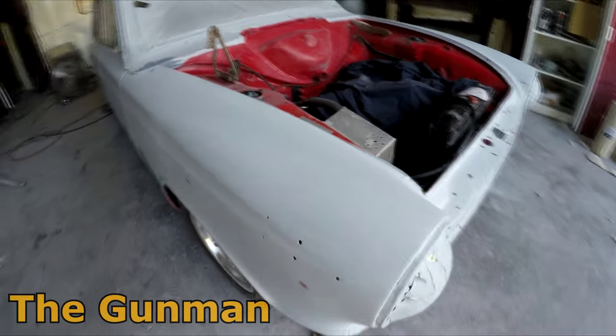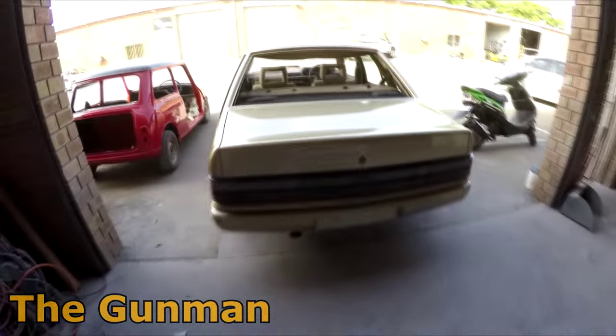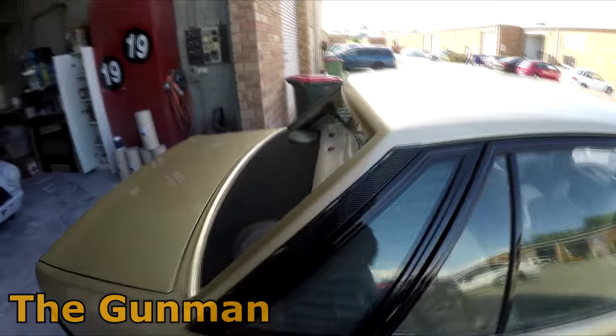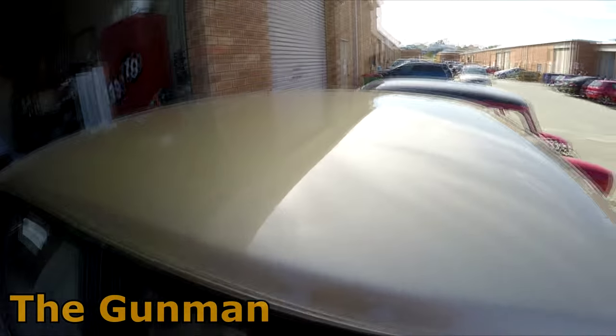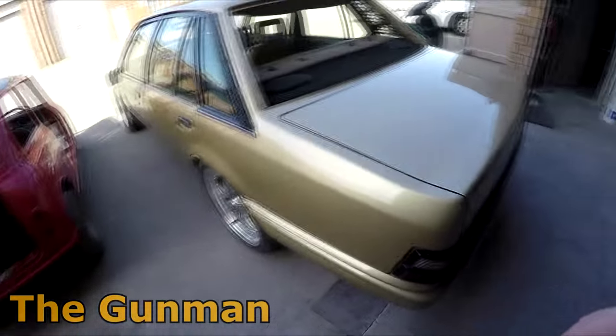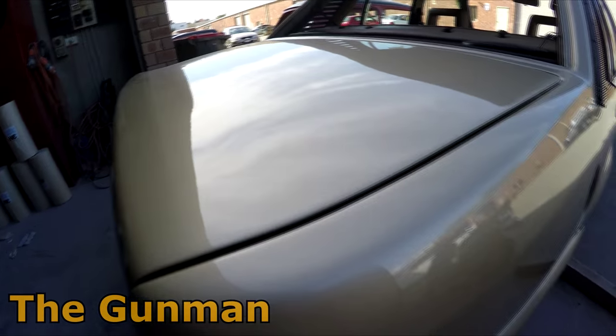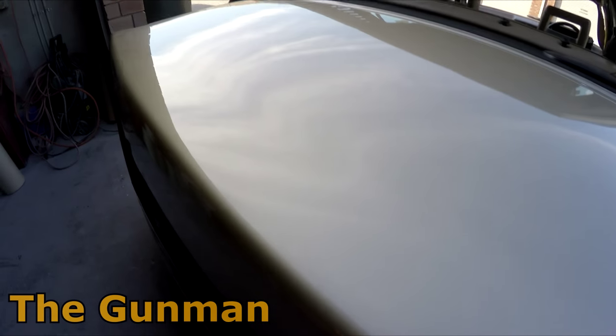Next up I'll be going over it with 500 grit orbital and then a 500 grit soft-back sanding sponge. I've just had this other car rock back up — I'm going to have to finish it off. For an off-the-gun finish, that Standox Express Premium Clear held a really amazing gloss. Good customer — didn't try being tight with the job, happy to spend money to get it right. A lot of the time when you put clear on that heavy it'll dull off a bit over time, but for an off-the-gun finish it's awesome. Anyway, back onto the Cortina — I'm going to have to cover that other car up so I don't get dust all over it.